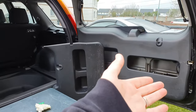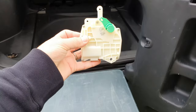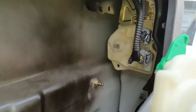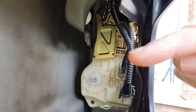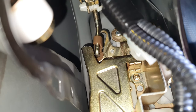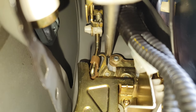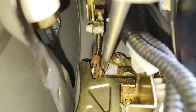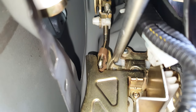As you can see I got the door open, and this is what the problem was — this is an actuator, and this is where it goes. This is why your door won't lock or open. If you look right there you can see your handle moves up and down — this is where the problem is. If you can get a screwdriver in there and push that down all the way, it will go past the point where the handle can push it and it will unlock the door. It's raining again so I'm just gonna have to do this in the rain.